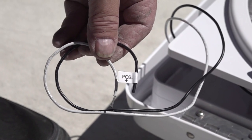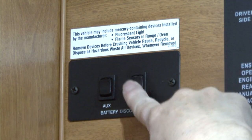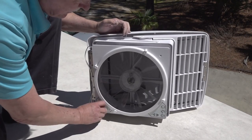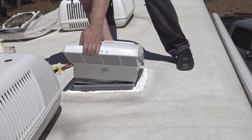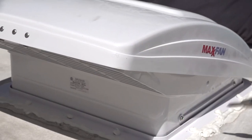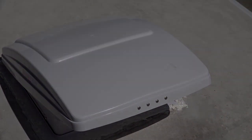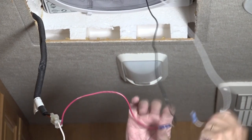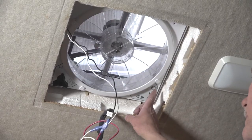For our installation, we need a 12-volt DC power source for the ventilation fan. The existing wiring used for the old fan will work perfectly. Turn off any 12-volt disconnect switches or disconnect the negative battery cable from the battery prior to making electrical connections. The Maxair fan must be open prior to making the wiring connections. With the Maxair fan open and the louvers facing the rear of the vehicle, lower the fan onto the roof receiving flange. Make sure the wires slide to the interior and don't get tangled or caught on anything. Make sure the fan is seated and fastened to the flange using the four 3/4-inch stainless steel screws — only use the screws provided. We are finished on the roof. Follow the fan installation instructions for making proper and safe electrical connections. Our fan uses a black wire for the 12-volt positive supply and white for negative. At this point, you can turn the 12-volt power on or reconnect the battery and test the operation of the new fan.